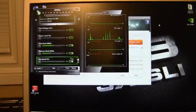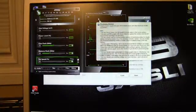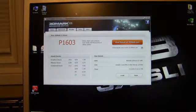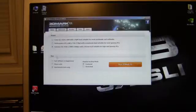The test has been completed on 3D Mark 11. We see a max temperature of the graphics card at 49 degrees — so that's 25 degrees above ambient temperature. We had a P score of 1603 and a graphics score of 1433. It's a little weak, but honestly I didn't expect that much out of this card anyway, being that it's not really made for heavy gaming. I'm going to run an extreme setting now and see how well it does, or if it even runs 3D Mark 11 on the extreme setting.